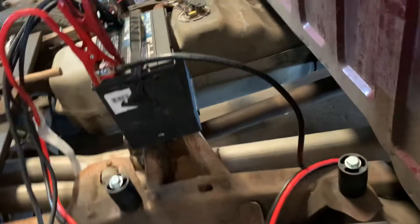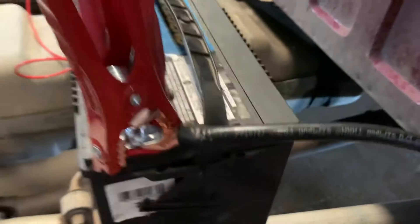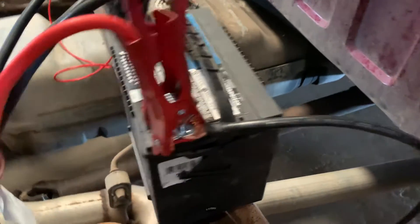It took me two days to work on this. Yesterday I had the video kind of made but it didn't want to work — I realized the cable just wasn't enough gauge, not enough power going to the starter. Today I managed to get all this sorted. I cut the new wire, put a lug on it, and connected it to the terminal.